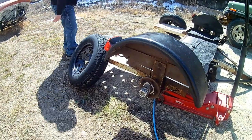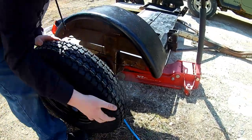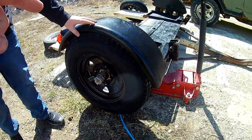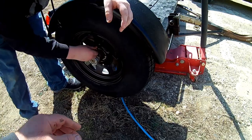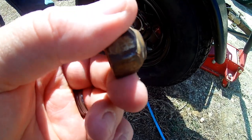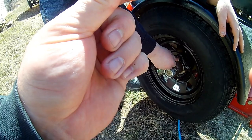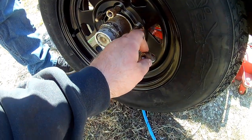You can lay her down there and we'll grab this new tire. Most all these trailer tires are pretty universal — they don't change a whole lot unless you get a special lug pattern. Get that on there and go ahead and grab your nuts and hand-tighten them all the way around first. These are an acorn-type lug nut with a little beveled edge — make sure those always go towards the wheel, because that centers the wheel on the stud.